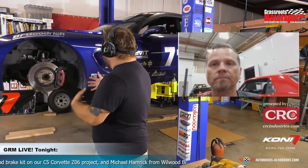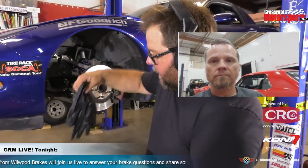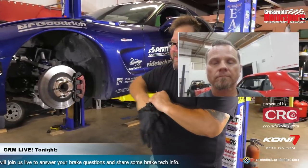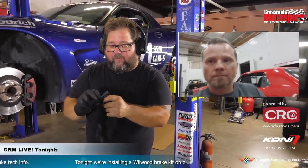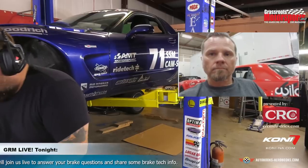So we're actually going to get into doing the install here, and I've gotten a little bit of this started. I've loosened a few bolts and gotten a few things ready. But I am going to stress a little bit that this is not something that the home gamer should be afraid of. There's not many complex operations involved here. It's mostly just wrench turning. You're not going to need a lot of specialized tools or equipment. Maybe the only thing you might not have already is a good set of deep 12-point sockets. I had a nice set of shallow ones, but I don't have a good set of deep ones. Great excuse for me to go buy some, though.